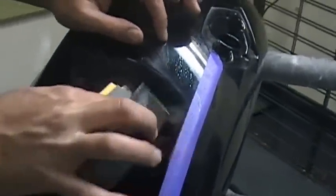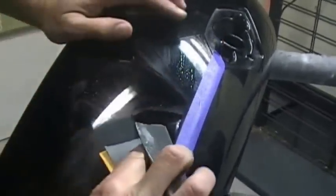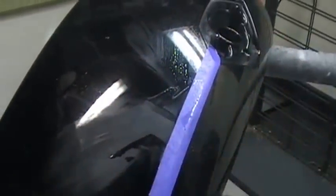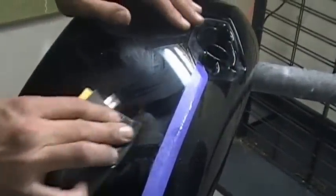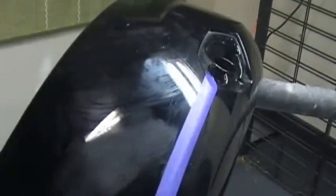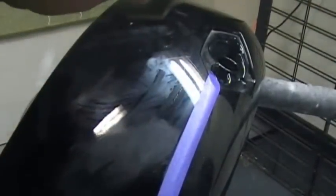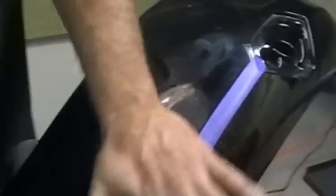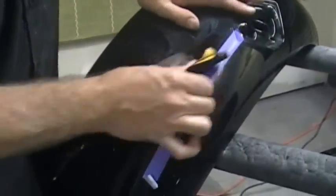So now you just have to keep doing the same thing, and I look like I am going like this but I am actually going in an X — going this way right now and then switching and going this way. Now I am getting down pretty far and sanding quite a bit and my scratch is still there. You have to determine how far you want to go, because if you go too deep — keep in mind we have already taken some layers of clear off here. So you have to determine: I got most of it out but I did not screw it up, it is better than it was. That is only something you can determine.